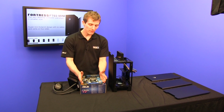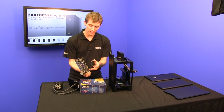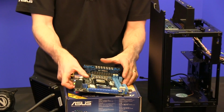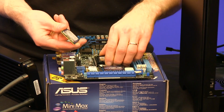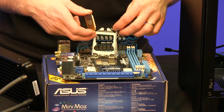In the next step, we have the motherboard set up on the motherboard box, which is a very convenient non-conductive test platform. All we have to do is align the backplate for our CPU liquid cooler that we're going to be using. Did I mention this was a liquid cooling small form factor gaming rig? Install our CPU. So this is a 3570K. All you got to do is lift up the arm.